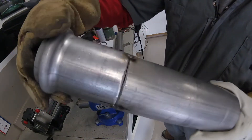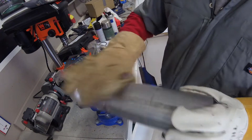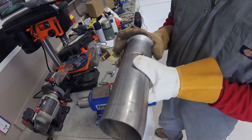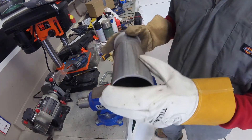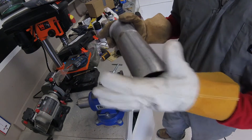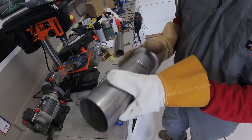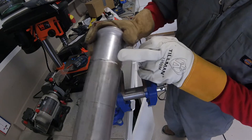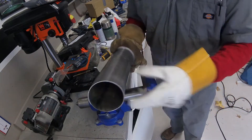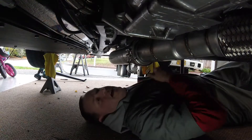You can see the tacks laid in there — now this is all together and not going anywhere. I'm going to take this back underneath the car, bolt it up, and mock up the next piece. I don't bevel the edges before I get everything mocked up — I mock it up, get it where I want it, put my witness marks on, then come back and finish my edges to mate together. I'm ending up with pretty tight seams, not much gap at all.